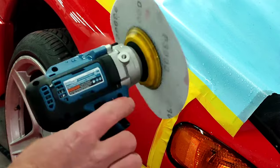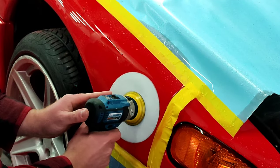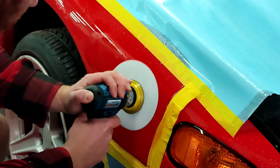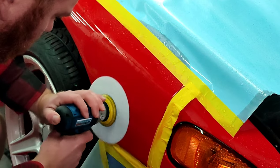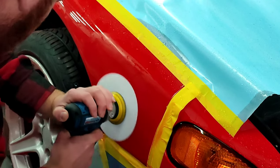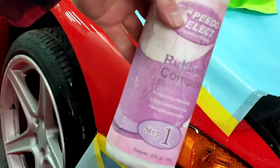This is going to ensure that we're not leaving behind any 800 or 1,000 grit scratches from that sanding process. Once again, give it a thorough wash. This is what you want to see — a nice sheen. You're looking for the sheen before you move on to 3,000. You can actually use a 6-inch pad on a 3-inch sander if you're too lazy to grab your 6-inch sander, but just know it's really only going to sand that little 3-inch spot. The 3,000 came out good.